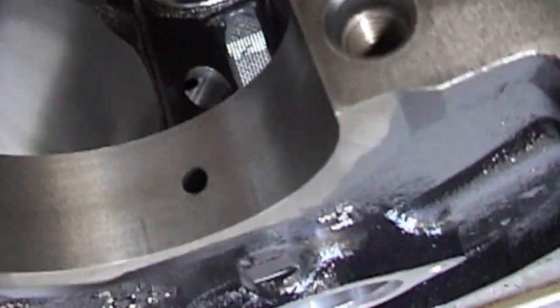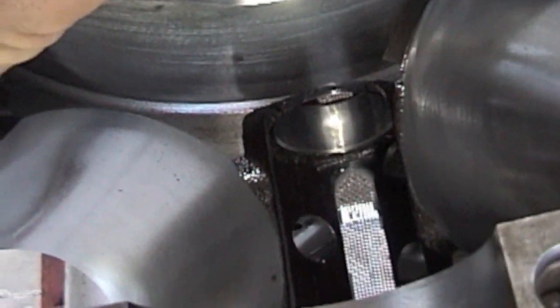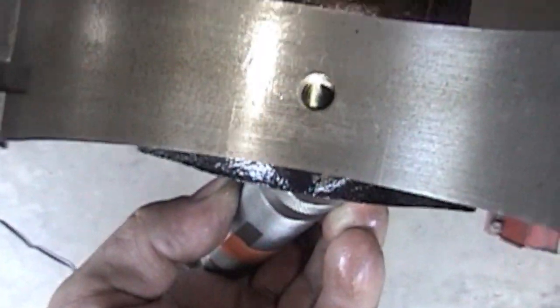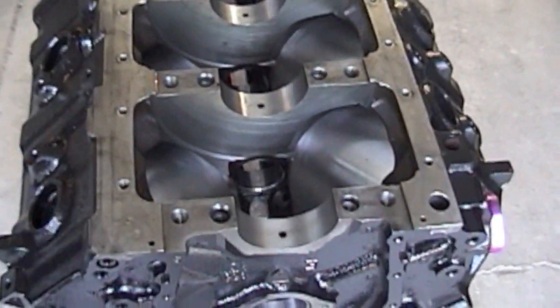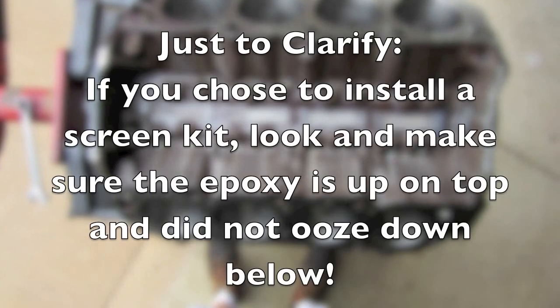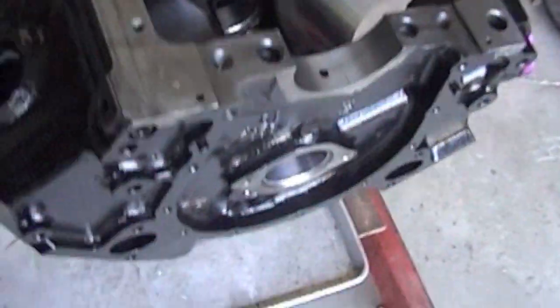Take a flashlight — you can see how it shines down through that hole. Just a quick way to check, make sure each one's got some light down there. Now that you've cleaned the block about five times using the wire brushes and your air hose, blowing everything out, making sure there's no particles in there — double check to make sure there's no epoxy that ran into your lifter or bore area. Make sure everything's spotless and clean.